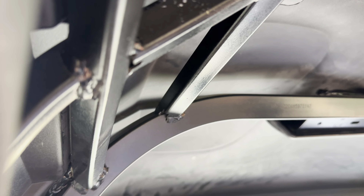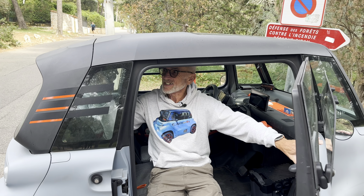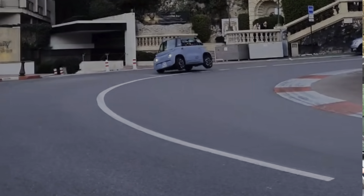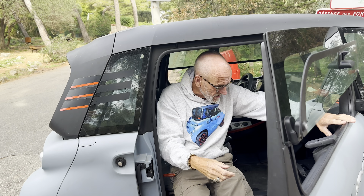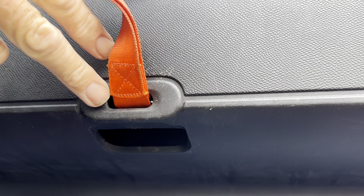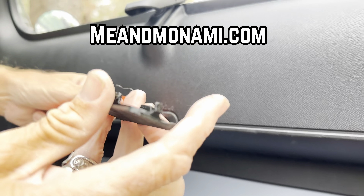Similarly, if you were to insulate these bars up here, putting some foam around them would give you a double purpose — a little bit more insulation and also a little bit of protection in the event of a Monaco-style rollover. The other thing that causes a lot of this draught is, if you can see under here, you've got a big hole here and a big hole around here.